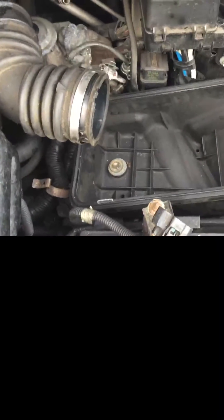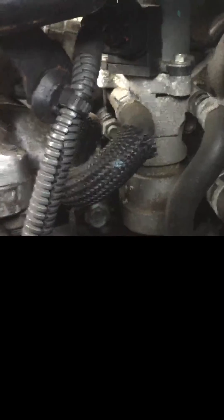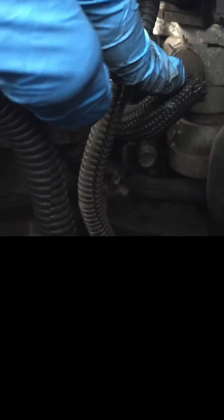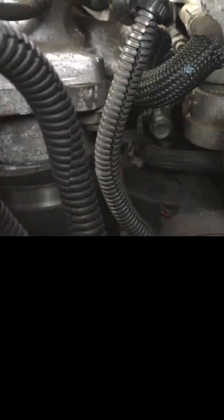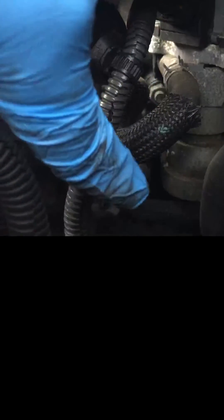I need to take out a few bits. First thing I'll take off is this one — I'll just pull this out, taking the whole unit including the clip. So I've taken out the air filter housing. What I need to do is take out the three bolts from here so we can have easy access. Now from here we have better access and a better view. I need to take out this pipe here and that pipe there with the clips — basically three bolts: one there, two, and three.